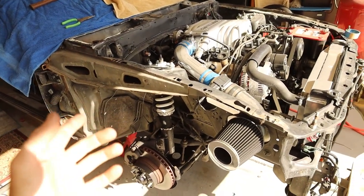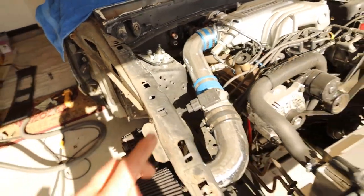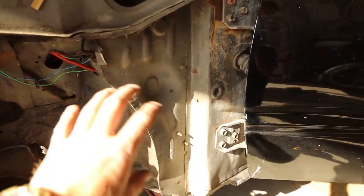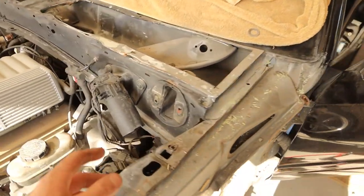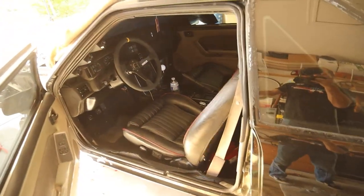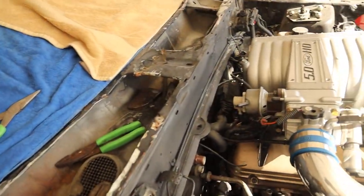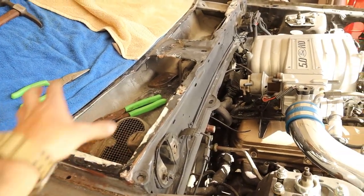Surprisingly it runs — actually a lot better. I took all the cut-up vacuum stuff hanging over here and threw it away, capped it. Over here there was a cruise control module I didn't know what it was for a while — ditched that and capped it. Now it runs pretty good, idles well. I didn't cut anything out that I need to put back, just some wiring to clean up. Now I'm going to work on actually getting the cowl welded in — I've kind of procrastinated cleaning everything around it, so now I'll go ahead and skin in the cowl.